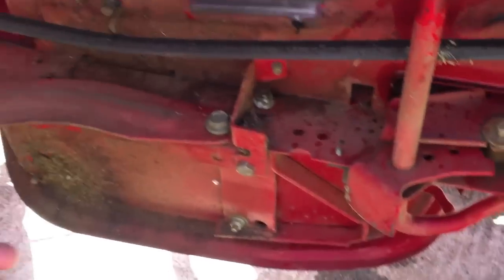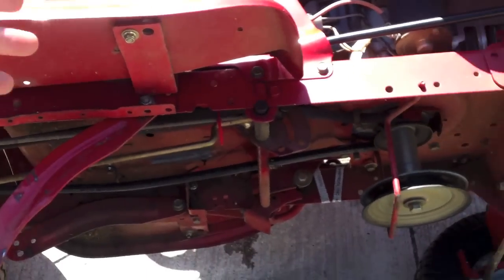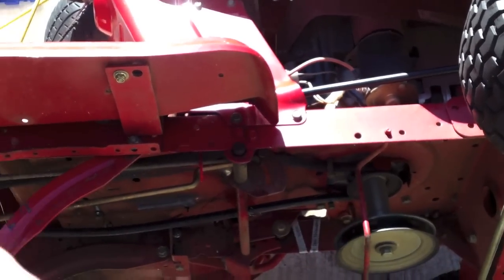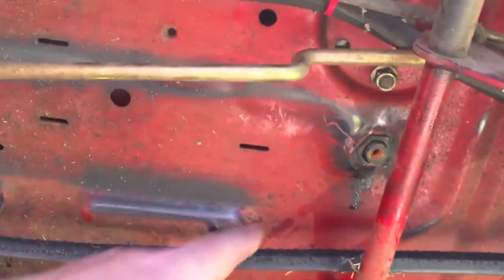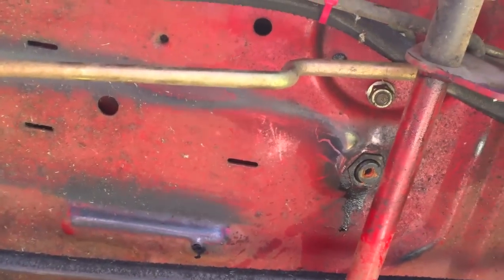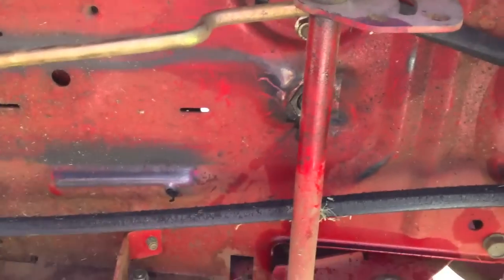I ended up taking the deck off and laying it on its side. Put it on a tire so it doesn't scratch — you can work on these for a good while, just be sure you don't leave it there all day. Tip it back down, let all the oil drain back down into the proper places. I ended up spraying it with penetrating oil, letting it sit a while, heating it up really good with a propane torch, then hitting it with a hammer and turning it to the left as I hit it. Hit it, turned it, hit it, turned it — finally it worked loose.